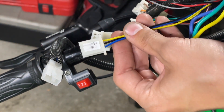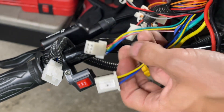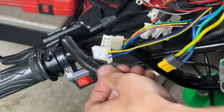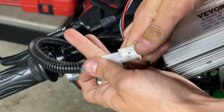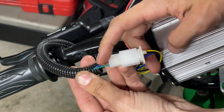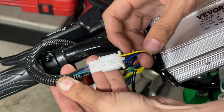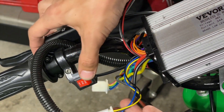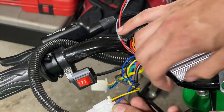If you want to add a three-speed switch, it's super easy. We have the three-speed option on our Vever setup and I have a three-speed controller. It's just a three-pin connector wired so my green goes to blue, brown goes to black, and blue goes to yellow. You can mess around with this combination to get different modes — either way you'll get different speed settings.